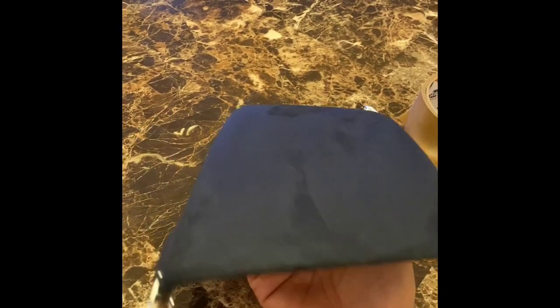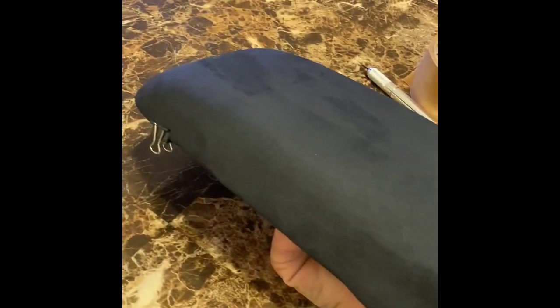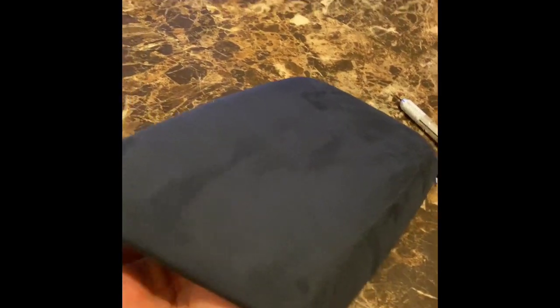The same with the ashtray, on these corner portions here is where material is going to kind of bunch up together. So just as we did with the ashtray, we're going to apply some clips to those corner areas just to make sure that the material seats down properly. If you can see here, as we're making these turns and that material kind of comes together, that's what I'm referring to as the material bunching up.